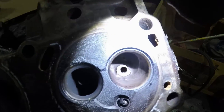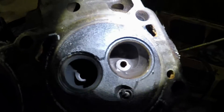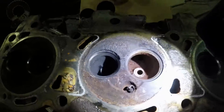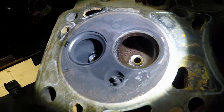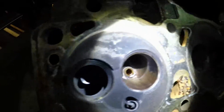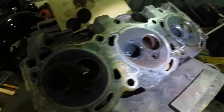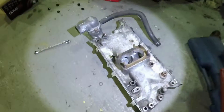Not much will be done to the inlet valves, the inlet ports - just a bit of a clean up so it flows a little bit better. That one's had some moisture in, that one's had a little bit of moisture. So we'll be doing some port work and we shall also be modifying the inlet manifold.